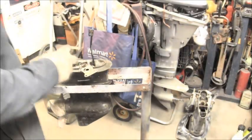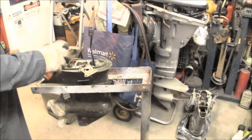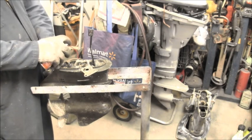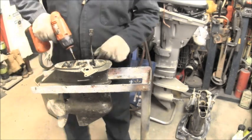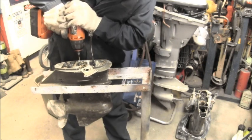Okay, we're doing the drilling. Drilling the hole right along the broke off stud. Put the stuff in there. And I'll probably drill another one on the other side too. Probably will, because that's what happens with an old salty. You got to finesse. Where was that hole at? Right there? Yeah, I'll do one over here. Straight down alongside the broke off bolt.